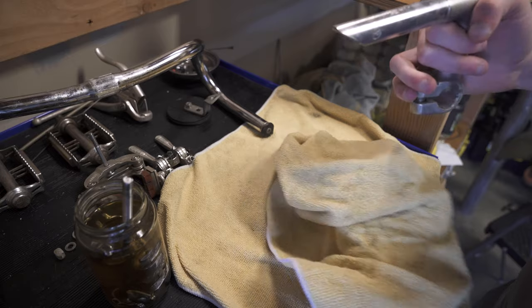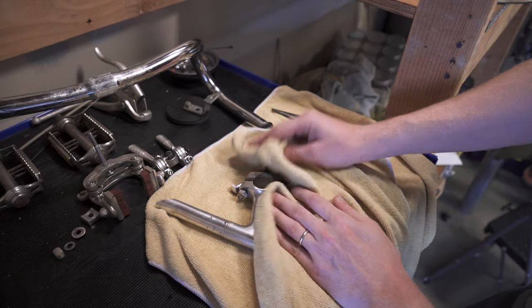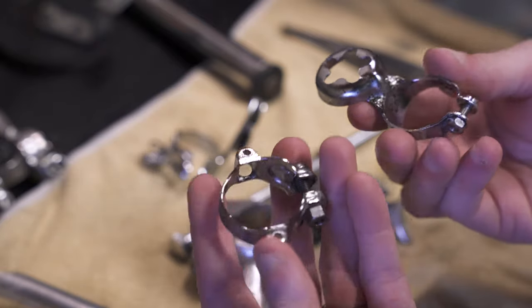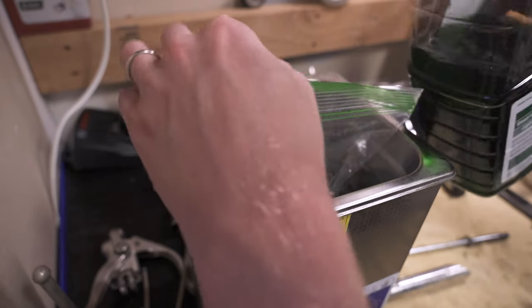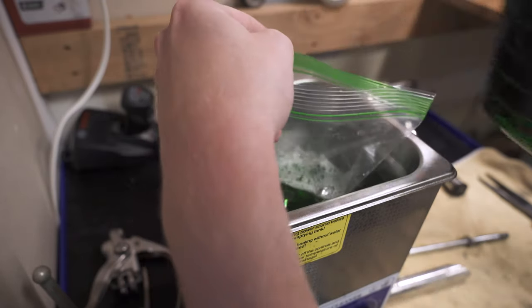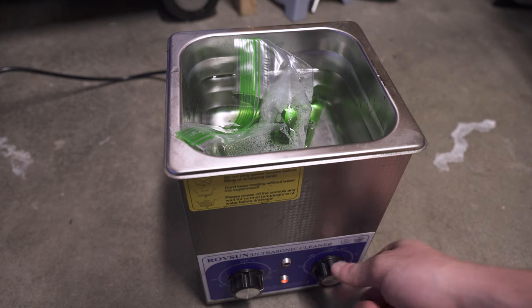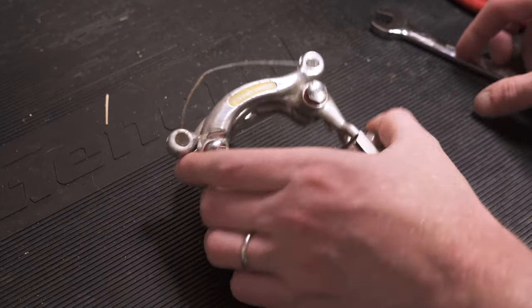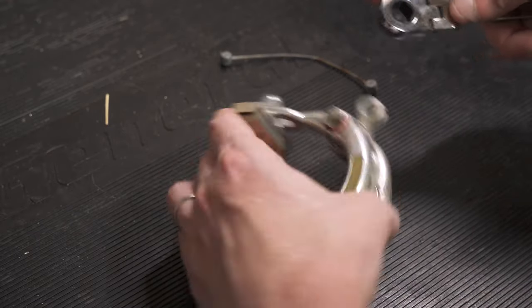Taking a look at the parts coming out of the Evaporust, they're already looking pretty great. A lot of the Schwinn chrome is pretty renowned, though this particular bike — the Traveler 3 — was not a high-end Schwinn; it was actually made in Japan, so not one of the Chicago Schwinn bikes with really good chrome. Moving on to degreasing, I'm using an ultrasonic degreaser. A little hack: save your degreaser and make it more concentrated by putting it in a Ziploc bag with your parts, then fill your degreaser tank with water for more concentrated cleaning while keeping it clean.